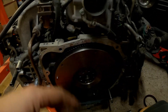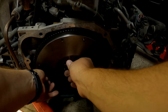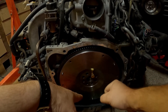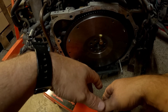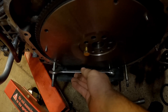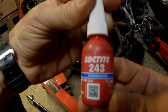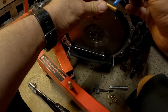We'll just put that on here. Add one of the bolts. Now we need to hold this flywheel while we're torquing it, so I've got a 19mm spanner and put it against this dowel and against this little pin on the flywheel — that's going to hold it in place while I torque it up. I'm going to put some Loctite 243 on these bolts, zip them up quickly with the rattle gun, and then torque them up to the specified torque, which is 75 Nm.